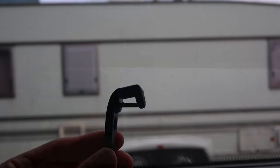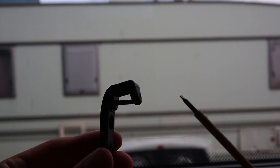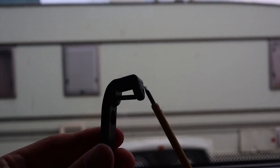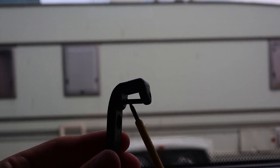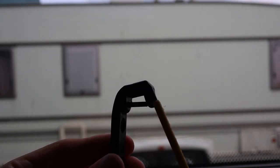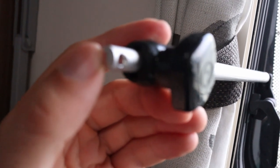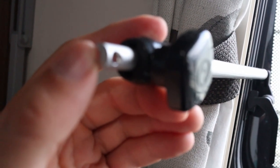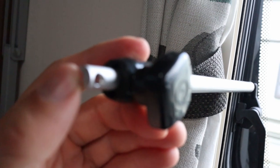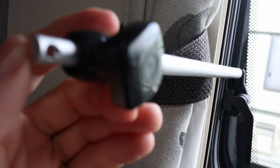The first thing is to take the two screws out. Here is the connector now taken off, and what you can see is that they've kind of bent the pin, so we're just going to push that back in. What basically happens is that this pin goes through the little hole at the end there. There's a little hole at the end here, and that basically goes through there. So what we're going to do is position that on and then screw it back in essentially. We're going to pull the pin through with a small screwdriver to get it through.